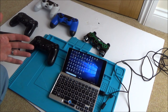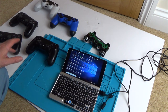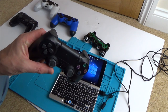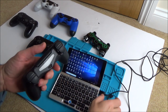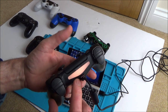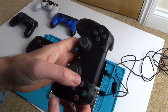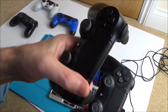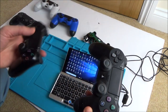I haven't tested anything wirelessly — when I do each video I will be testing it on the PlayStation 4. But initially I'm going to start on this one here. This looks like the analog stick doesn't want to go up, and then when you start hitting the left trigger it starts drifting upwards. Also, this is the version 2, because you can see just through the light bar here, and it's got the grey buttons. The version 1 has got black buttons and it's only got the light bar at the back — it hasn't got the little slot here.